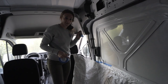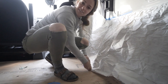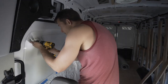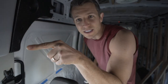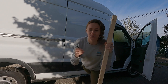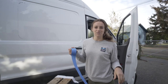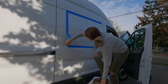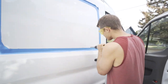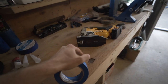We want to make sure that the metal shavings are somewhat contained and don't fall into little crevices and cause rust in the future, so we're taping down a sheet to catch them or at least funnel them into an area we can clean up easily. Katie traced it out and I'm just going to drill a few holes, placed pretty close together to give Katie a nice template to work off on the outside. We're using a Sharpie and a piece of wood to connect all the awl punch-outs so we have a nice clear line to trace with the jigsaw. To protect the paint, we're putting painters tape down on the outside edge, and I'm taping the bottom of the jigsaw so it doesn't scratch the van at all.